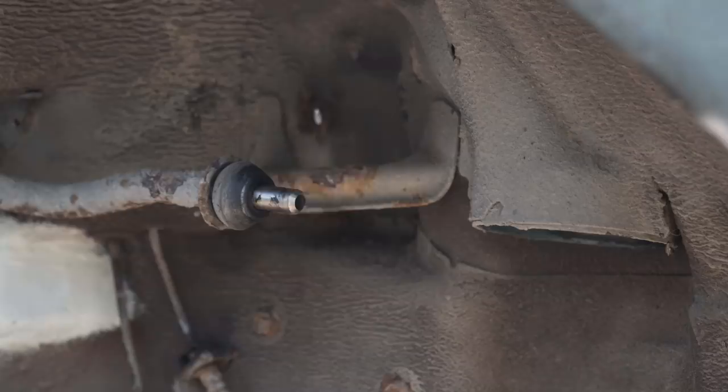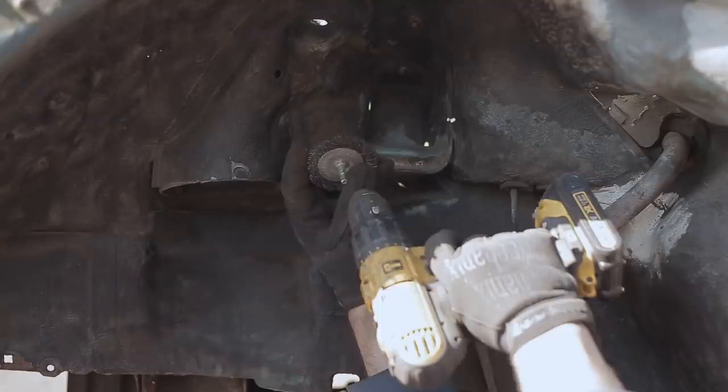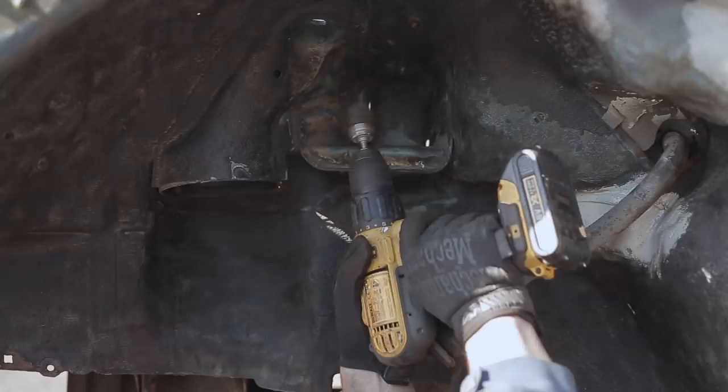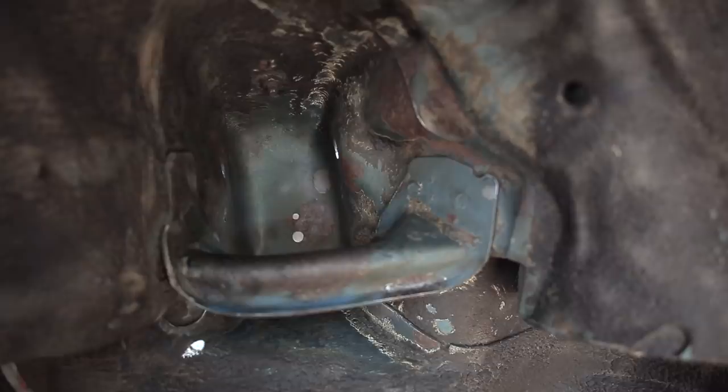And as I go to clean off the road dirt from the inner arch, there's another set of tools that I don't use that often but are very handy, and those are standard wire brushes that will fit in a cordless drill. They're very cheap, they're available almost anywhere, and they come in a range of sizes, which is a crucial thing. It means that they get into places that the knotted wheel on the grinder or the grinder in general just won't get into. They're not nearly as effective in general, but for stuff like this where it's only light duty work, they can make all the difference. You could look at it this way.